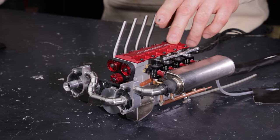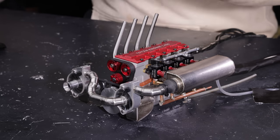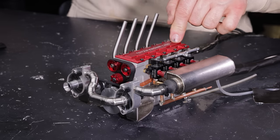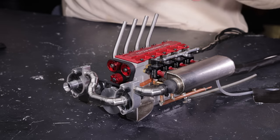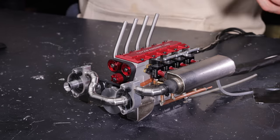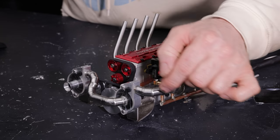That was a short run, but man, did that thing sound mean. And that's exactly why I have the high speed camera set up, to capture failures like that. It looks like my belt tensioner blew apart. I think I just need Loctite on everything. I could hear the supercharger whine after the engine shut off while the superchargers were still spinning. I couldn't hear that with the engine running. Another thing is that the boost pressure was pushing out my intake pipe.